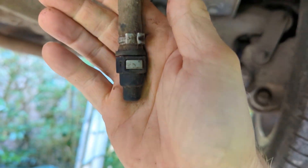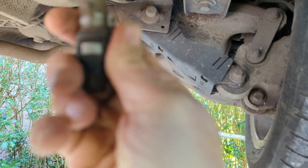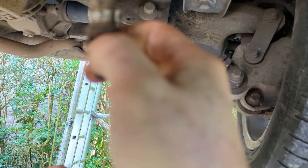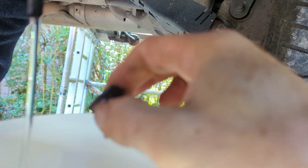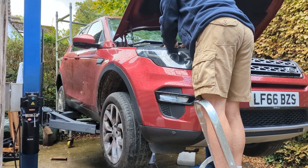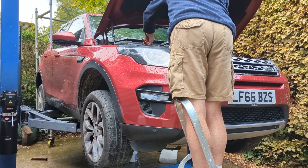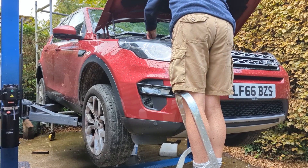Basically you've got this little clip here — it's not a screw-on cap, the cap just goes round and round on an O-ring. You push this in, like on the fuel line, you push that grey part in and pull. Can you hold the pipe? Because it's going everywhere. And out comes the old fluid. We're going to drain that and we'll see when it's empty. Before you actually drain it, you're going to get an airlock, so you have to take the cap off the filler point under the bonnet to let the air in, to let the fluid out. Otherwise it just runs for a little while and then starts gulping. So the lid's coming off now, then we'll finish the drain.